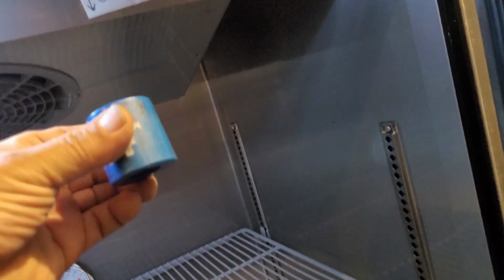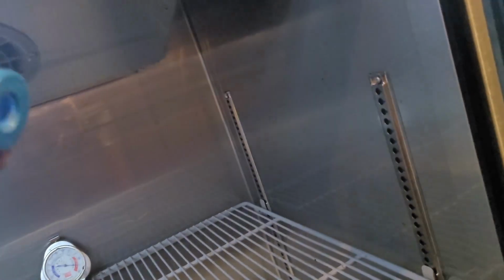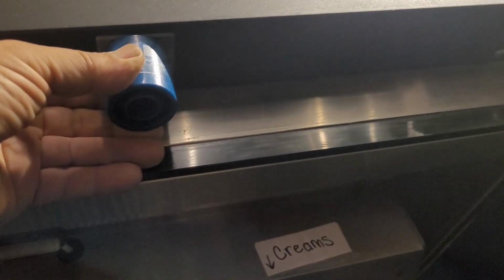Now, I would like to show you one more time how this switch works with any magnet. This is just a regular magnet you can find around you. If you bring it closer to the bottom of the sensor, it detects that the door is closed, turns off the light, and the fan starts working. I think it should be about half an inch close. Otherwise, the sensor couldn't detect the magnet. It is off now. It is on.